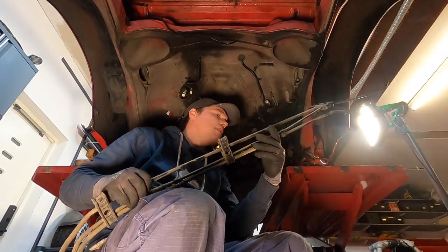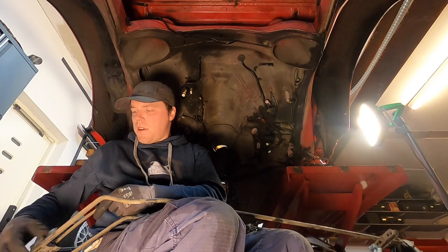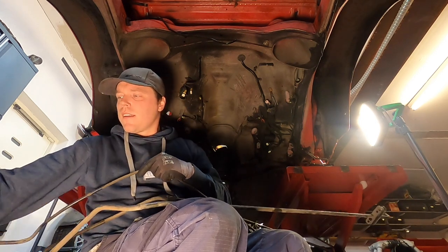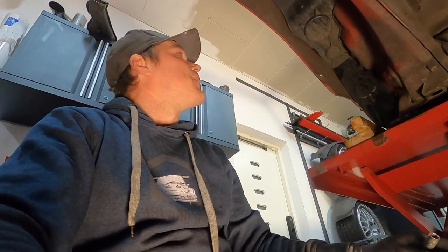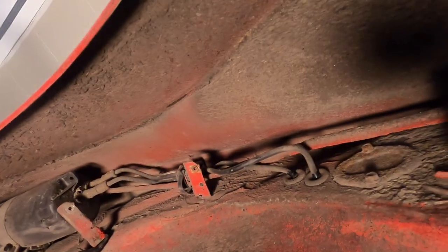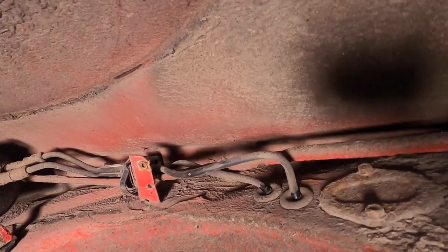I got the fuel pipe assembly out and wanted to show you something. One of the things I'm taking out is this center pipe here — and if you remember in one of the old episodes, I spoke about this emission thing where you have the vent pipe that vents the top of the fuel tank. It's actually this hefty pipe here, and it goes all the way out to the outer fender where you have a carbon canister. The carbon canister takes the fumes from the top of the expansion tank above the fuel tank, sucks them into the canister, and then sends them back to the intake manifold.